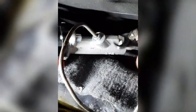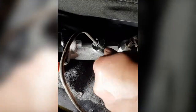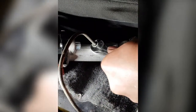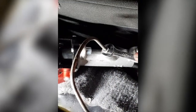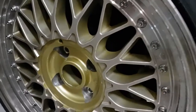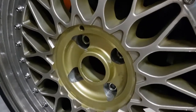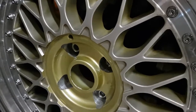Uhley's wagon, which we looked at before, and they did the install of that one. He actually has drum brakes. My coupe had a really crap house diff in it. So basically I put a late model diff in it. I actually put Commodore disc brakes on it. You can't really see here, but anyway. I got the rotors done to Gemini pattern, so the Gemini is a 4x100, but it still runs a Commodore caliper and all the other bits and pieces.